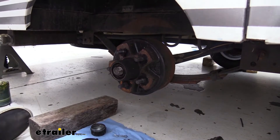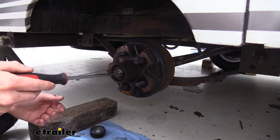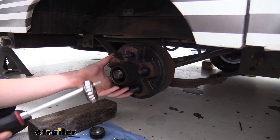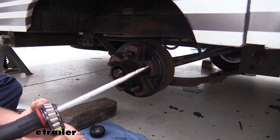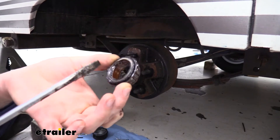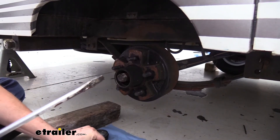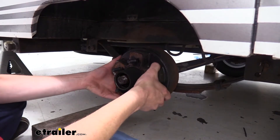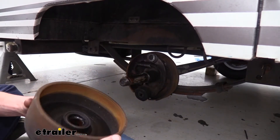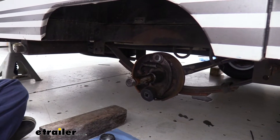Our hub can now slide off, but the outer bearing is right there. I like to take a screwdriver and put it on the edge so that when I pull out, it'll catch that bearing. You can see some moisture has entered — it's got a rusty color rather than the black or red grease you'd normally find. So we're going to slide it the rest of the way off and set this whole assembly aside, as we're replacing it.